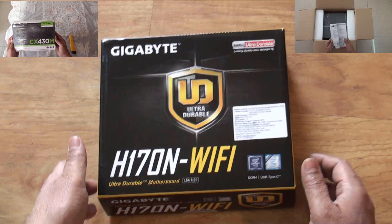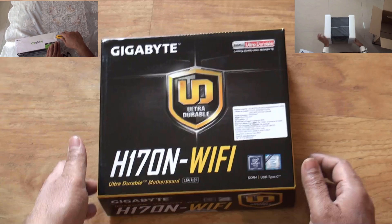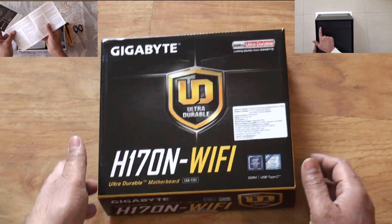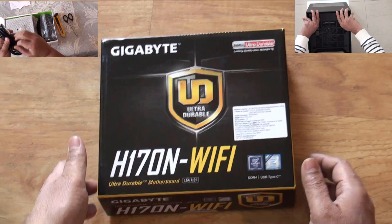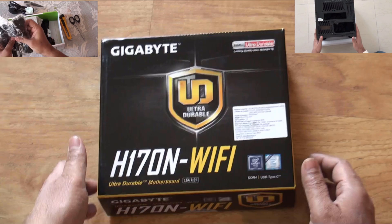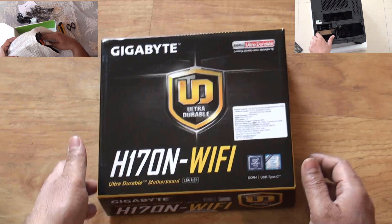Hello friends, in my earlier videos I have mentioned that I will be building a home theater PC. For this PC, I have decided to use a mini-ITX PC case and Intel 6th generation processor. While exploring available options on the net, I came across that Gigabyte offers mini-ITX motherboards which support 6th generation Intel processors with in-built Wi-Fi and Bluetooth module. The Intel AC8260 module supports dual-band network connection and provides a data transfer rate of up to 867 Mbps. I have all my media files on my network storage, hence a faster data transfer network was very much needed for my home theater PC. So I decided to go for a mini-ITX motherboard with in-built Wi-Fi module AC8260.